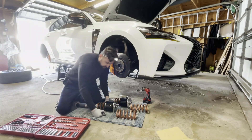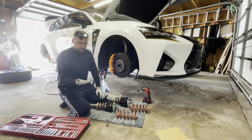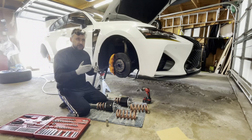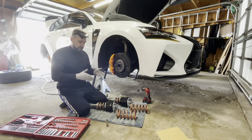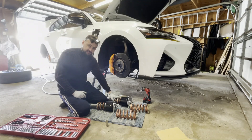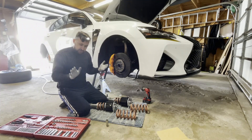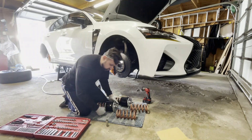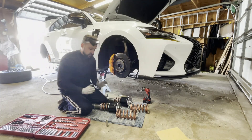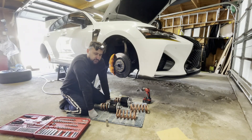I'm doing this because when I originally purchased these springs, I was probably the second, third, or fourth person to get them from Lou from Modern Japan. He originally suggested 14 kilogram front and 10 kilogram rear spring rates, said it's a nice comfortable smooth ride, so I went with it. That was about three years ago.